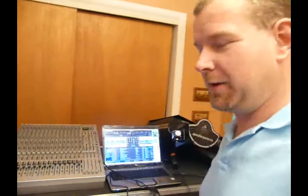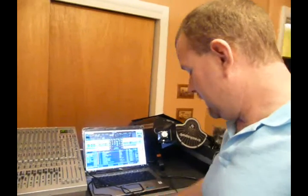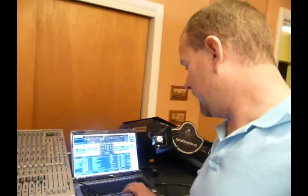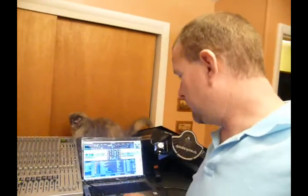You can hear it — hopefully you can. It's loud as anything right now. So what you need to do: go down to Radio Shack, $14, get yourself a ground loop isolator. This ground loop isolator works perfect. The sound is fine. Everything is perfectly fine.